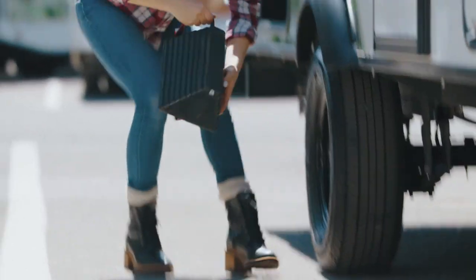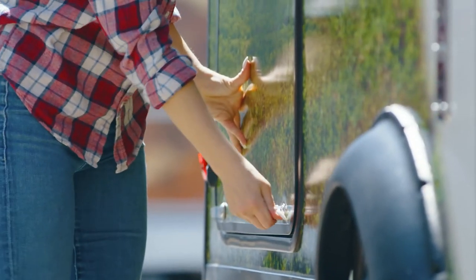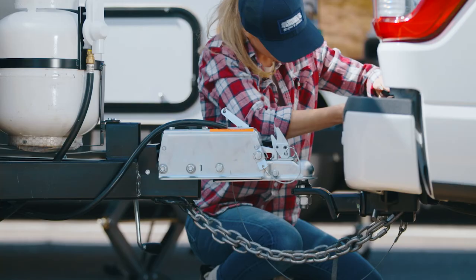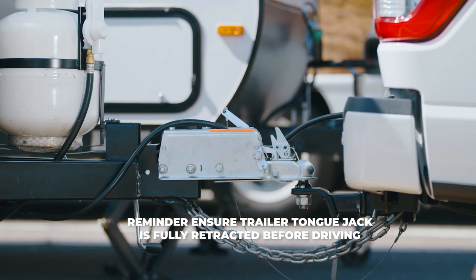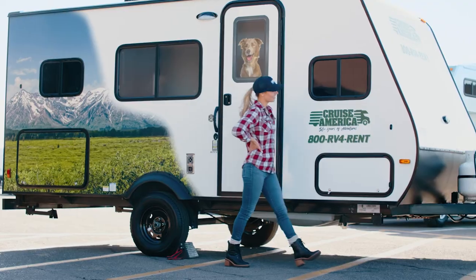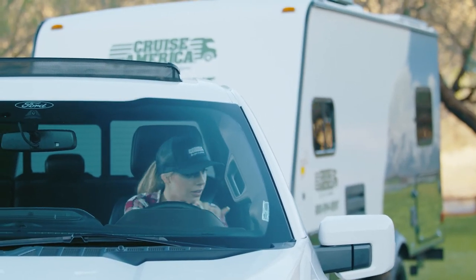Remove the tire chocks. Check to make sure nothing else is in the way and remove as needed. Final checklist: check if the cord, chain, or hydraulic brake lines are dragging and at risk of touching the ground. If so, loop them around as needed, allowing enough slack for turning. Check to see there are no compartments or debris in the path of the vehicle. Lastly, ensure all your signal lights are operational.